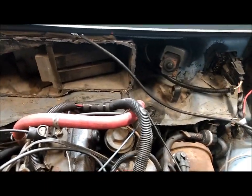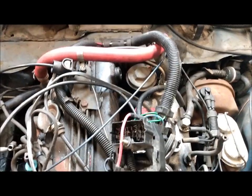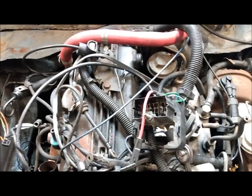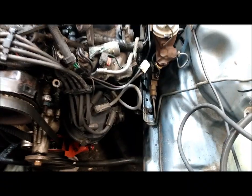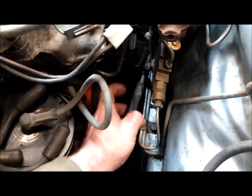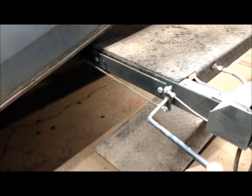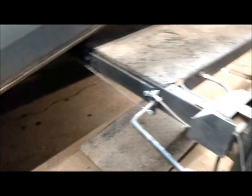Now it's down to the drive shaft, the motor cable, and the four bolts on the cross member that are holding it — and I'll move the cross member later as well. One more important thing: get a piece of hose — I've got a plastic plug here in the end, it's a short piece of gas hose. Make sure when you take the fuel line off that you have a hose to block the line.